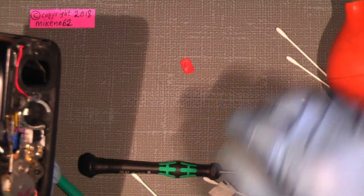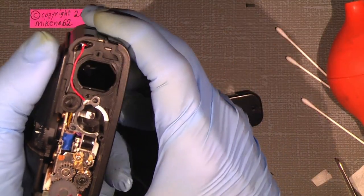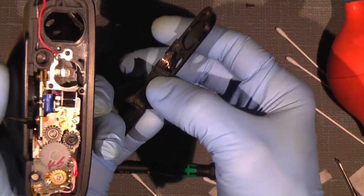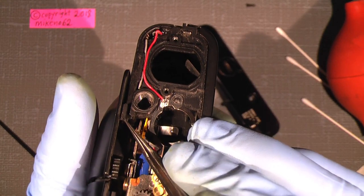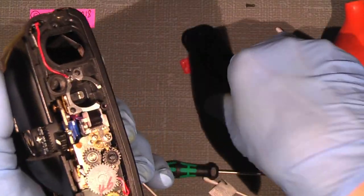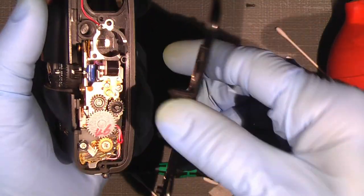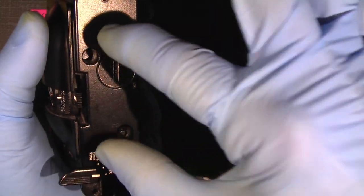So now, putting on the bottom cover, one should have the film door not closed, because it's not possible to put on this area here. You cannot simply put it on, because there's a kind of a hook here, this area here. So you have to open the door, almost open, it's all fine, and have the focus pin sit there, and then you can add the bottom cover.